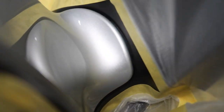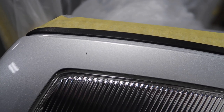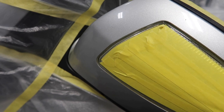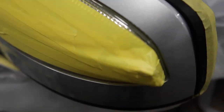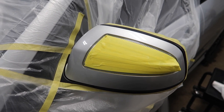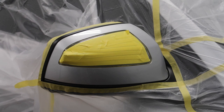All the way down there, and all that's gonna get peeled off after. Since there is a gap between the black plastic and the actual painted side mirror, it'll end up cutting itself off along the edges. If for some reason it doesn't cut off and it does get attached, you could grab a knife and heat the blade and then slowly, slightly just cut it where it's attached. We've got the light taped up. Now we're gonna warm up our can of hyper dip and we're gonna start off with four light coats, and then we're gonna do four solid wet coats — but not heavy enough where it's gonna drip.